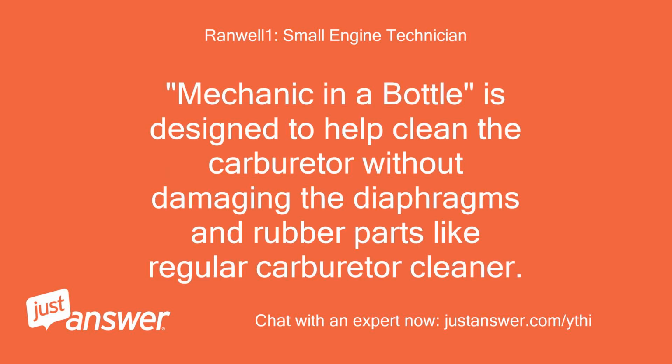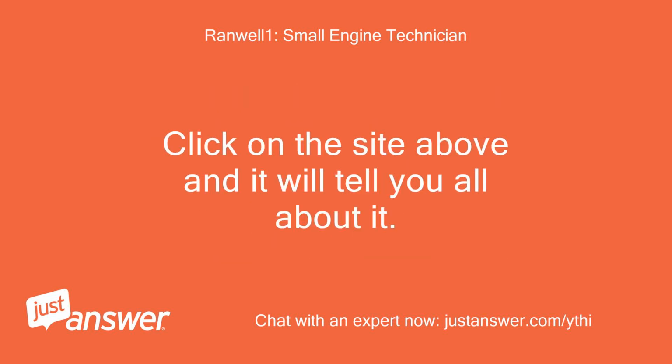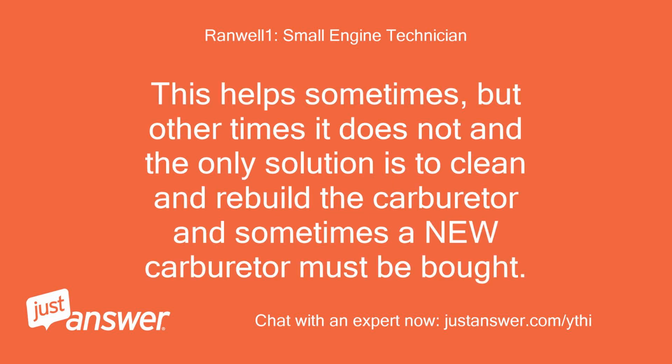Mechanic in a Bottle is designed to help clean the carburetor without damaging the diaphragms and rubber parts like regular carburetor cleaner. Click on the site above and it will tell you all about it. This helps sometimes, but other times it does not, and the only solution is to clean and rebuild the carburetor, and sometimes a new carburetor must be bought.